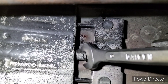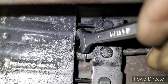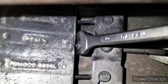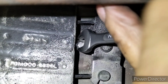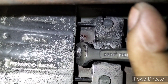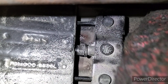Use the pliers to hold the other side of the rod while turning the adjusting nut. It is better to do the adjustment while the handbrake lever is in the relaxed or down position so we can adjust easily. At the same time, we can check the proper freeplay or clearance of the mechanism — it's important that it's not over-tight, because that may cause the tire to lock up.